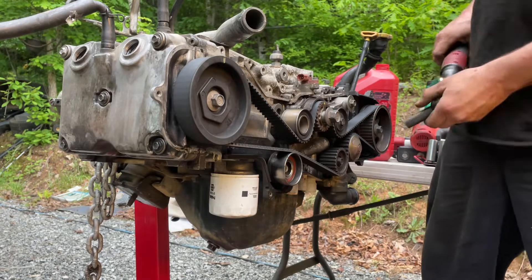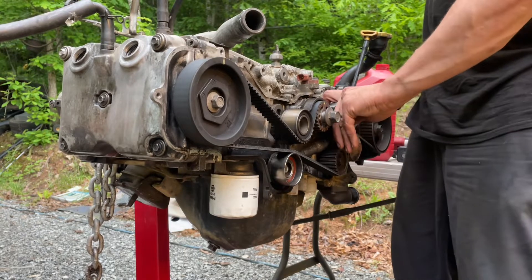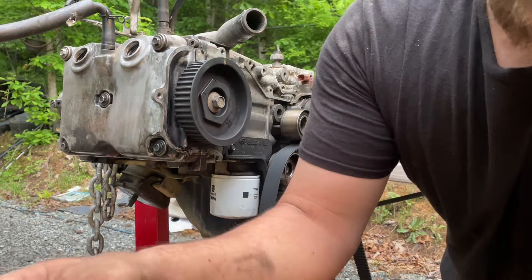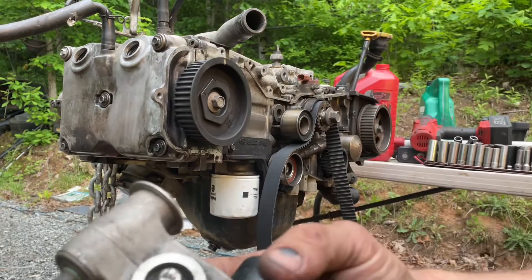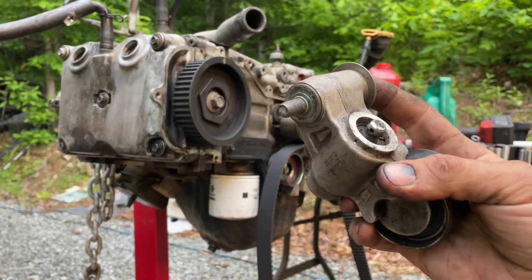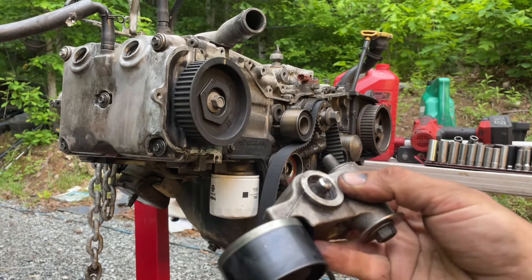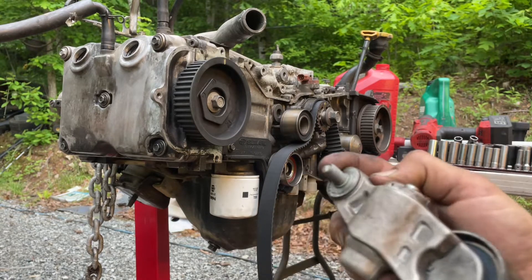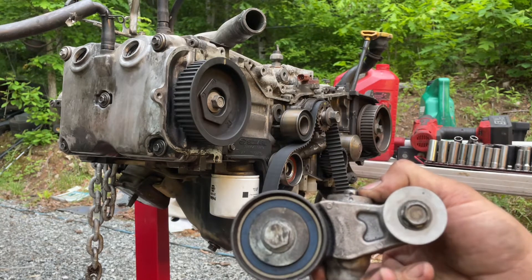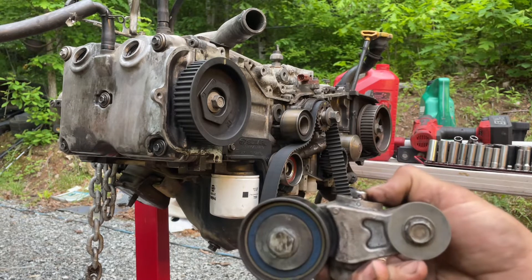Take a 14 millimeter and take this tensioner off. That's the way you do it — tensioner comes off first. There's a washer, and then there's an O-ring back in there. See that rubber O-ring? It keeps that washer on. When you put this back in, it's the last piece you put back in on your timing. You've got to take this and put it in a vise, crush it down, and put a pin through it. It's a pretty strong hydraulic cylinder — you've got to push it down with a vise and put a pin through it to hold it.